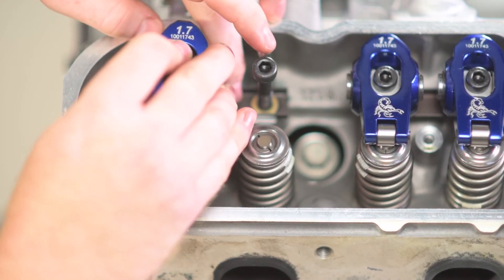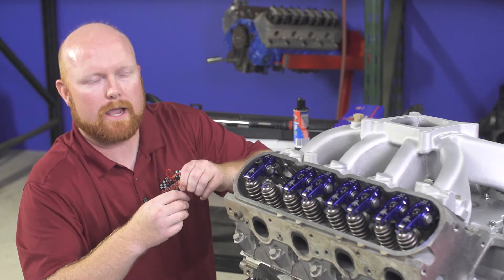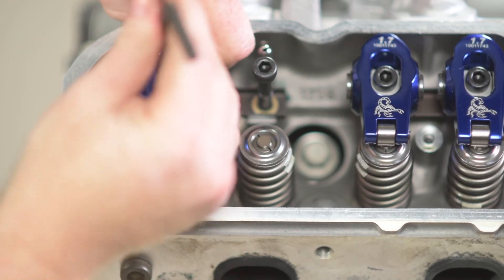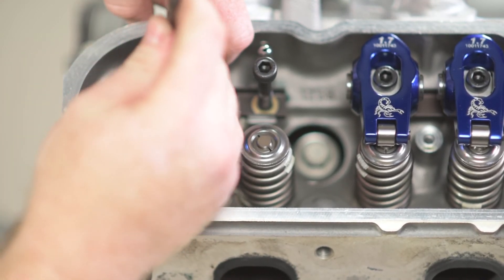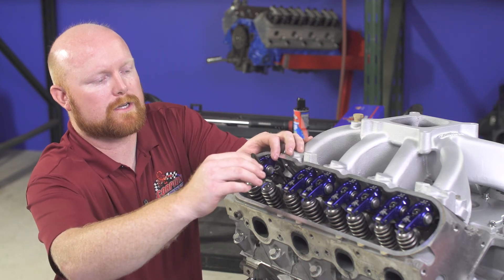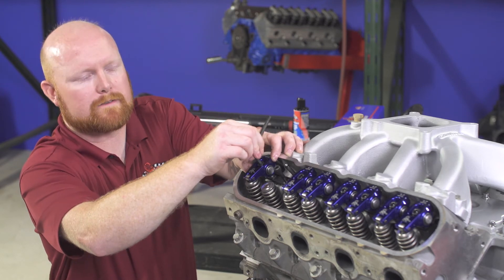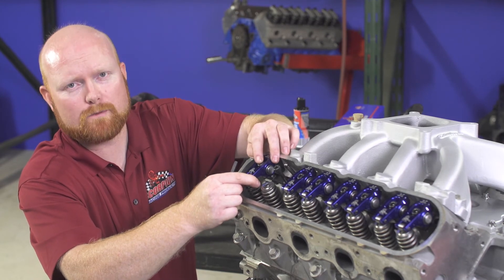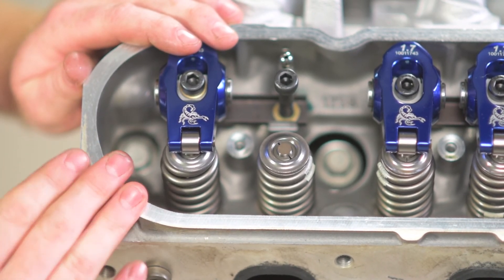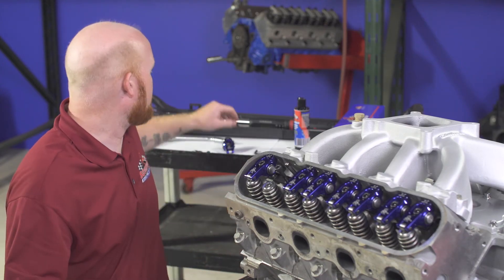Just as before, start the bolt in the hole, let the rocker fall onto the push rod, hand tighten the bolt first, then grab your Allen wrench and run the bolt down until it's almost flush with the face of the washer. Check for zero lash — now I have no upward or downward movement, I'm at zero lash. Place the Allen wrench into the bolt and rotate a half turn — I'm at about five-eighths of a turn, that's perfect. You want between a quarter and three quarters. If you're running an aftermarket cam with a high RPM application, stay to the lighter side of the preload, about a quarter turn, so that if your lifters get into a pump-up situation at high RPM you don't have issues.